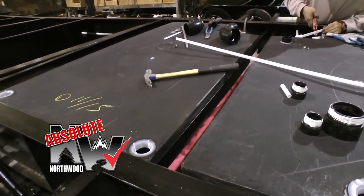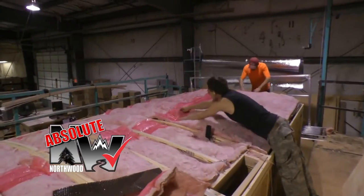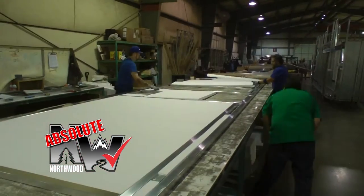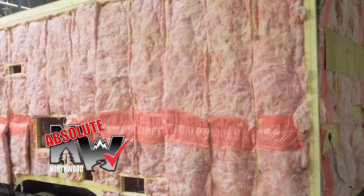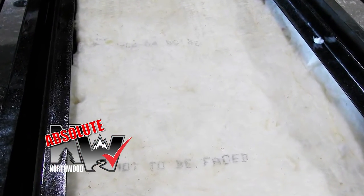All conditions, fully insulated, suspended, heated and enclosed holding tanks with enclosed and insulated valve compartments. Northwood's four-season insulation package with R18 batten fiberglass and R15 reflective foil in the roof, with high-intensity 2-pound virgin block foam and aluminum superstructure models, or residential batten fiberglass and traditional wood frame Nash models. All floors are insulated with thick batten fiberglass.